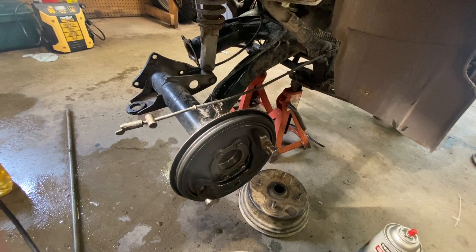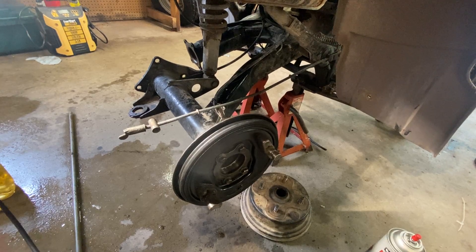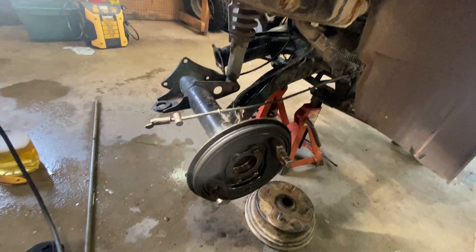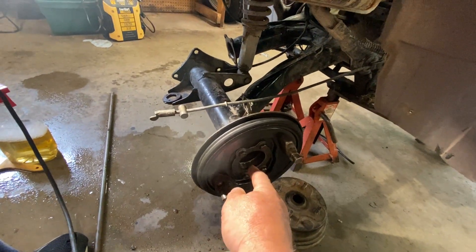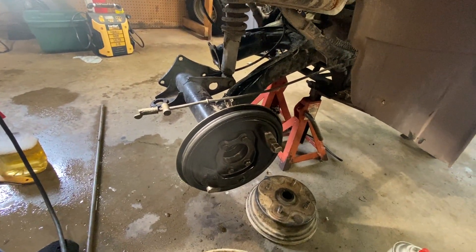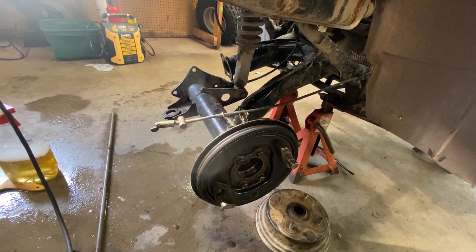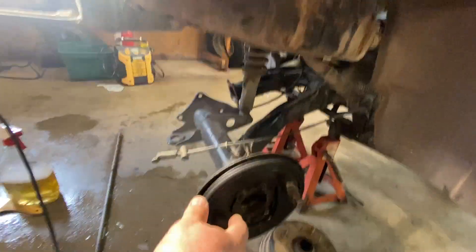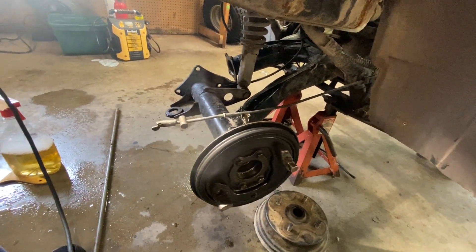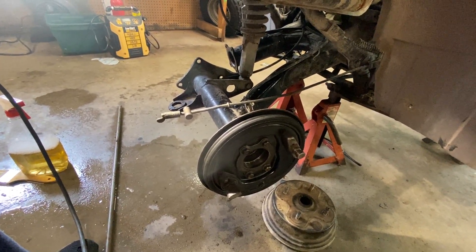The final drive came out, kind of. There are two layers of bearings and seals — that's what I gathered from the manual and what I pulled out. There are two steps in there; the second one was rusted in place completely. The bearing was just completely molded to the axle from rust and heat, so I had to cut it apart.